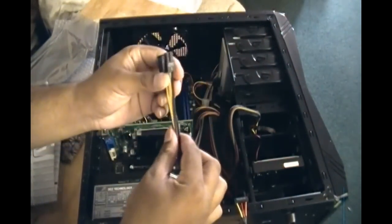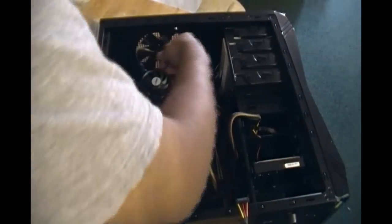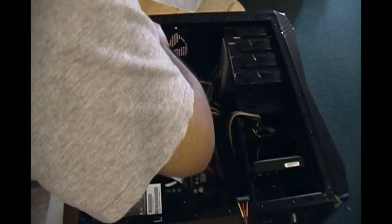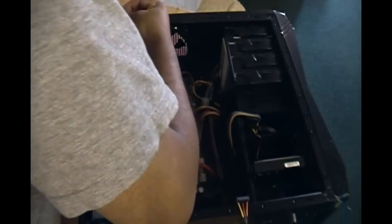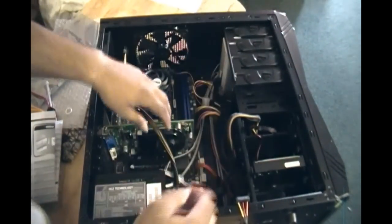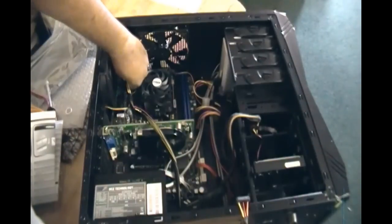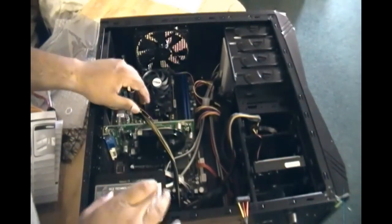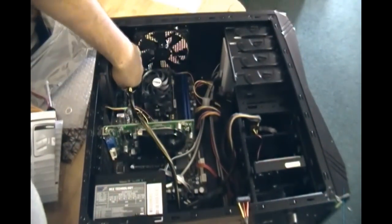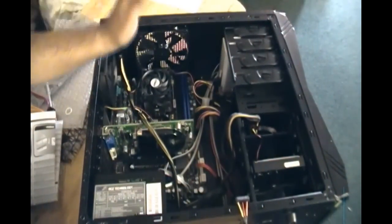There are more cables here — these are the CPU1 and CPU2 power slots. You have to actually install these into the CPU connector on the motherboard. It's a little short and goes all the way on top. It went in there — it's a little sloppy and it's going to touch the graphics card. The power supply could have made the cable a little longer, but I can't really move this around — I don't have much freedom. This connects directly to the motherboard and will provide extra power to the CPU. And that's the connection we need there.